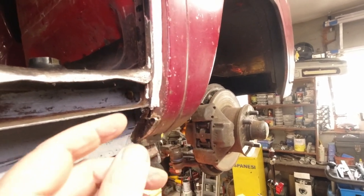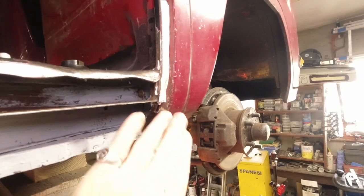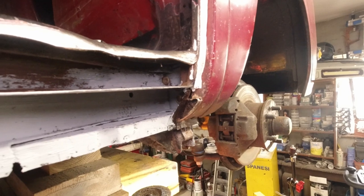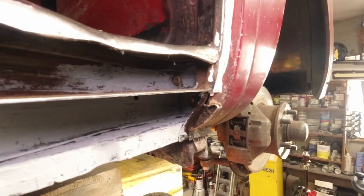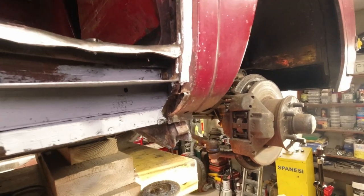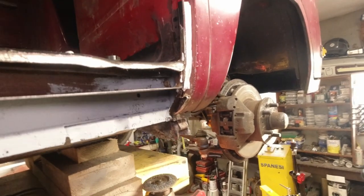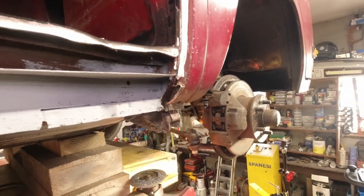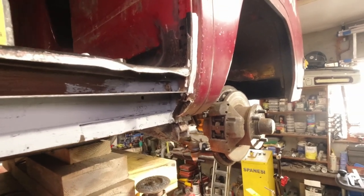Pull your rubber out a little around the corner and check it, because this is prone. This is an area where the water gets in and it doesn't really get out that fast. It just takes longer to dry out. I've said it plenty of times now, but that's an area you need to keep your eye on, at your sliding door in your bay, or indeed cargo doors or wherever. At the bottom corners. Bottom 6 inches again is what we're talking about.